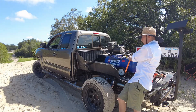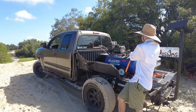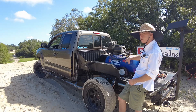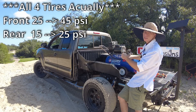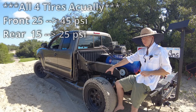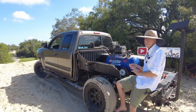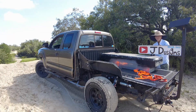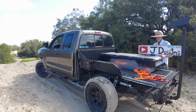This here is actually just a 13-gallon air tank. I pretty much use it like a poor man's power tank — it's stored at 125 psi and I can get two tires off this air tank, then do the rest with a little plug-in air compressor. I do have quite small tires, these are 30s, but it works really well running a lightweight setup like I am today. That's probably one of my favorite things about this wing-and-sign combo — this whole toolbox actually fits underneath the sign.